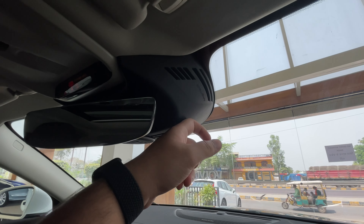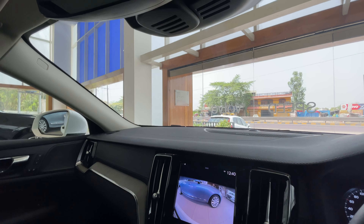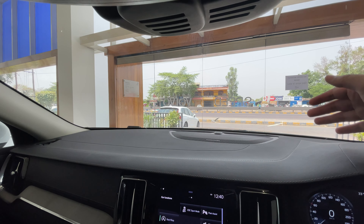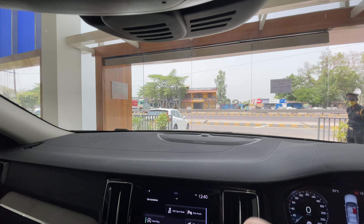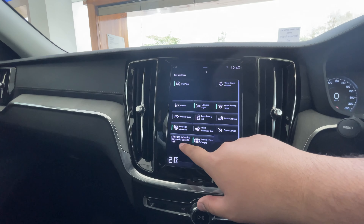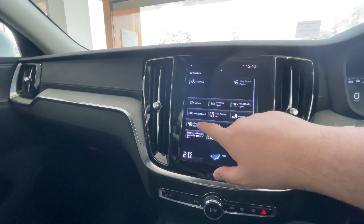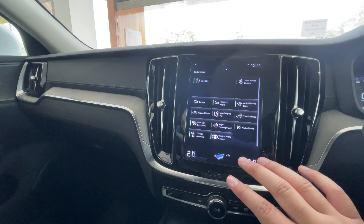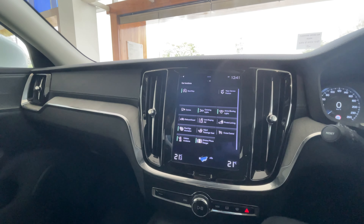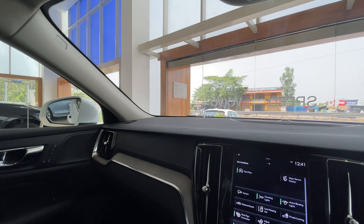Here, this actually holds the radar-based system which helps the driver aids — that would be the adaptive cruise control and front collision warning. This also has automatic braking when approaching a vehicle if you don't brake — collision avoidance. The steering wheel actually steers you away from a collision; you can turn it on or off as you please. This can also give you road sign information, lane keep assist, and active bending lights. So when the road markings turn towards the left, the light actually bends towards the left with the help of the markings — really cool.